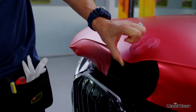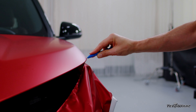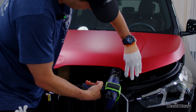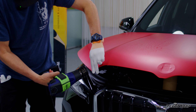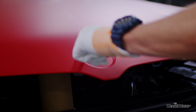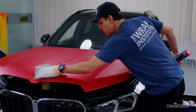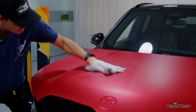Make a decision on how you wrap the film. In this case, because the film was relaxed to the edge and then under the edge, you can angle the blade away and cut it safely — no need to wrap farther underneath the hood. Always finish strong by adding heat to the edge to activate the adhesive and ensure long-term hold. Once everything's set, form any recessed areas — in this case on the emblem — and add heat to activate the adhesive. The final step is to give it a wipe down using a preferred aftercare product, in this case Triple S. Don't use alcohol as this can dry out or damage the satin metallic finish.